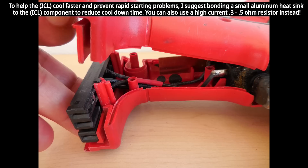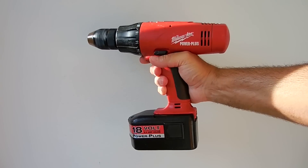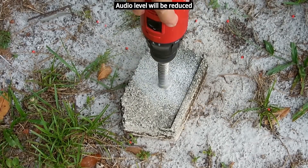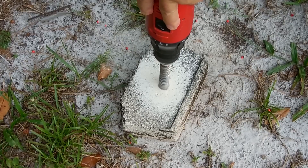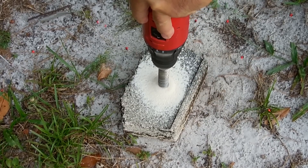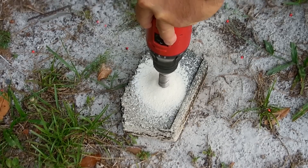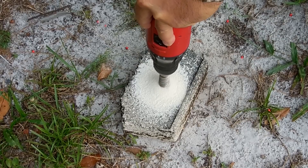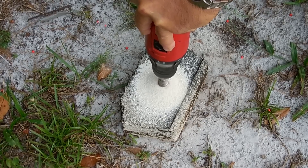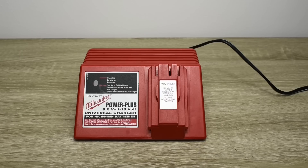Because there's plenty of space in the handle and it's also ventilated, I'm installing the inrush current limiter right at that location inside the handle. With it installed the drill works just fine. The drill had no problem at all drilling through concrete.